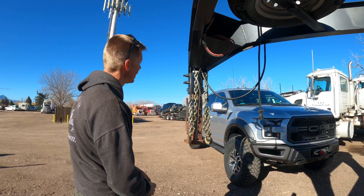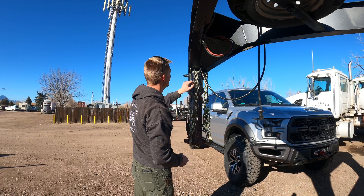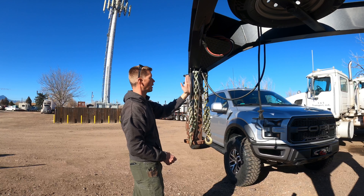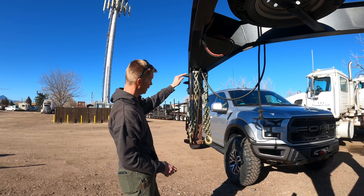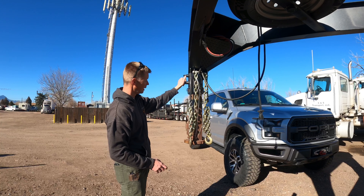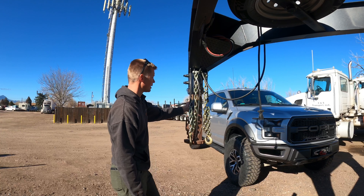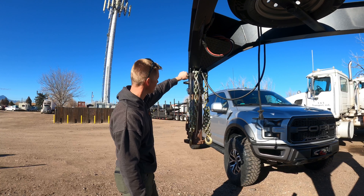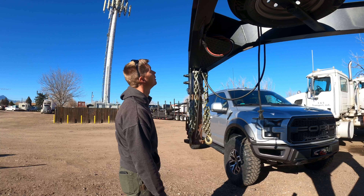Safety chains are coming off these little gussets right here — that's just quarter inch plate on both sides, cut to the angle to match the neck to the coupler. The inside of the coupler is four inches by four inches, the outside is four and a half by four and a half, which tells us this is a quarter inch wall tube. These set screws and nuts take the slack out once you adjust it so this isn't rattling around and moving.